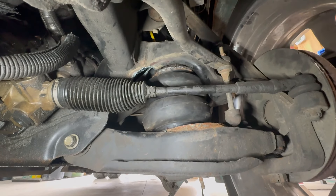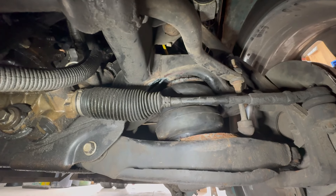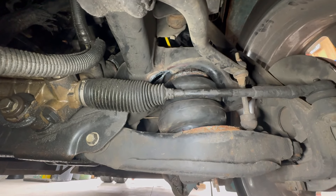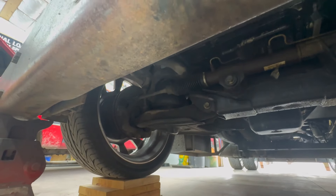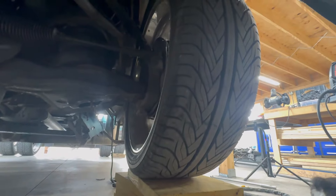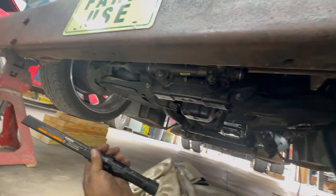You can see what we cut out did make a difference. There's still a little bit there — I've marked it with a marker — that needs to come out, but I think we're going to be pretty good on this side once I get that last little bit trimmed out. While I was at it, I went ahead and did this side as well; it's been marked and is ready to trim. I'm going to get the wheels back off and trim a little more over here, then put the new bag in on this side so it's done, and then we'll move on to the passenger side.